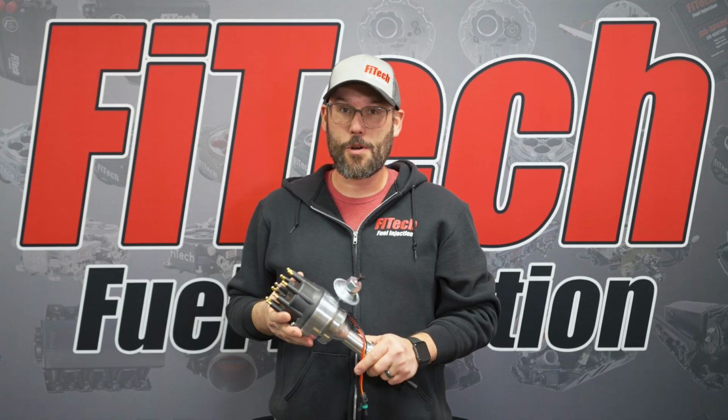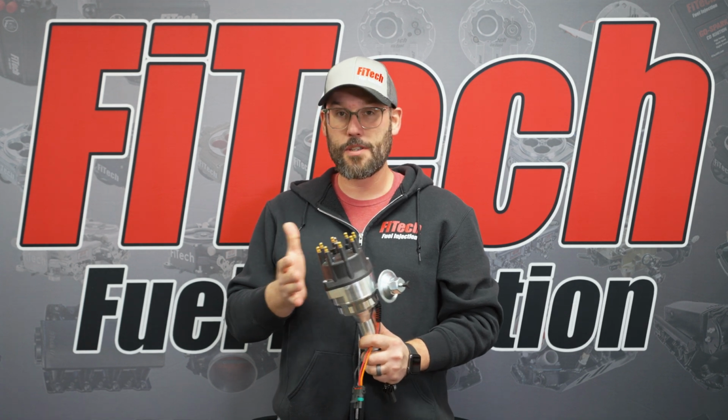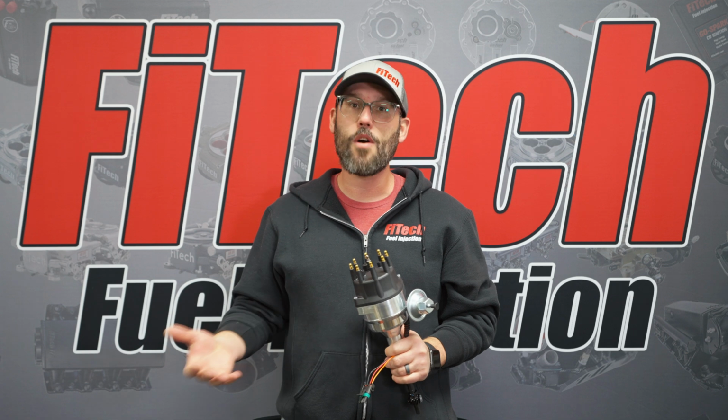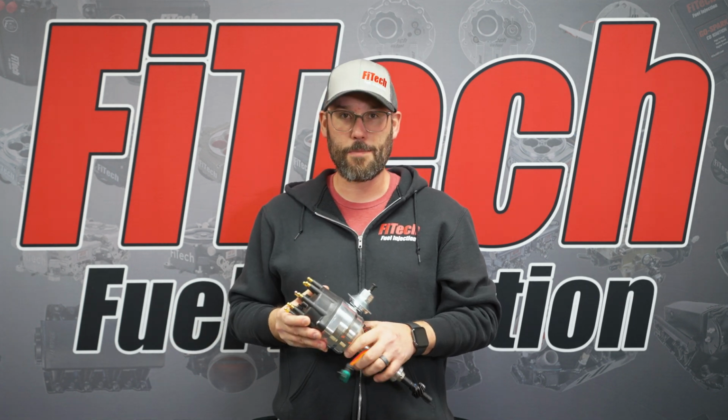The next distributor we have is the ready-to-run style distributor. As you can see, the cap is a much smaller design, so this will add additional clearance to firewalls or to the back of the intake. Some of the intakes, like the Ultra RAM for a small block Chevy, won't fit an HEI, so your ready-to-run distributor would work best in those applications.